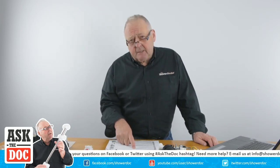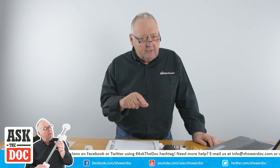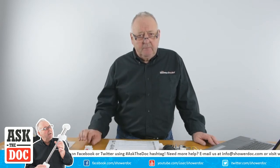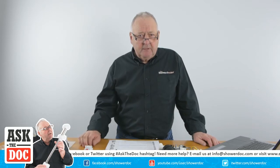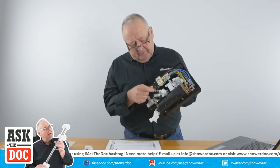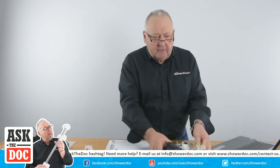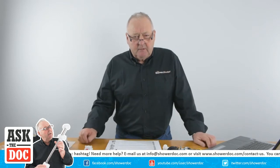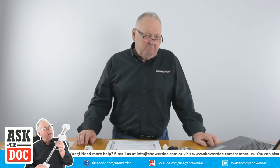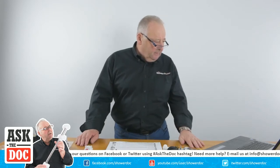When you said the shower has power but won't turn on, I suspect what you've actually got is a faulty solenoid rather than a faulty latching switch. It may be worth looking at our video - we've got a video on how to test solenoids. You should be able to recognize it in your shower; they're all roughly the same. I would check that your solenoid isn't the problem, because that's the most likely thing.